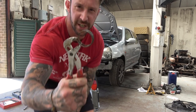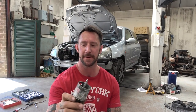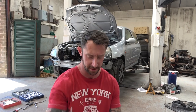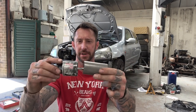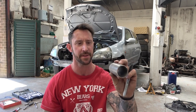You know what this is? It's the work of the devil. Basically what we're going to do next is put some holes through the crossmember of the Clio. We're going to use this hole-cutting saw which is roughly the same size as roll cage tube. So once we've drilled a hole through the front and the back of the crossmember we'll be able to slide that tube through and weld it either side — that gives the strength back to the car but allows the air to pass through the crossmember.